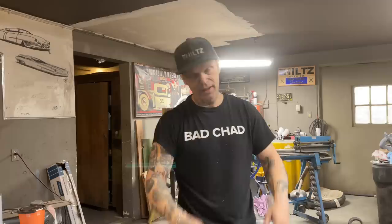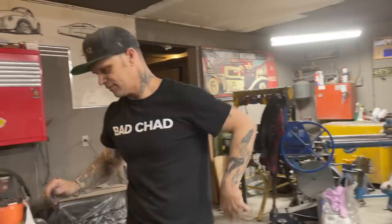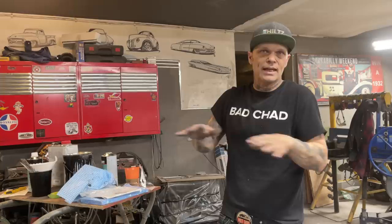I'm not going to let it dry completely so you can run it out and drive around. I'm going to make it dry to the touch. You know what I mean? I can put my hand on it and no paint comes off on me. The paint's on there smooth. I'm not worried about laying out and laying down. I've got it laid down with the gun. I want it to dry up a little bit and then we'll hit it again.